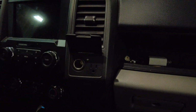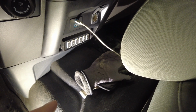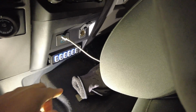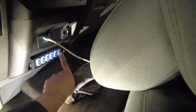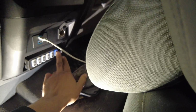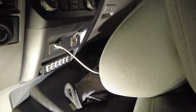Oh, on this truck we have a control box down here. Kind of hard to see though. Let me get a light. Okay, so on this truck, you can see there's a control box right there. And this is kind of cool. It came from STL Lighting. Basically, always hot. Every one of these buttons is fused, and it's a circuit, except for F. F, when you press it, is just momentary 12. So F allows you to change patterns. So any one of these can be a light, and F just applies 12 to the light. So the cool thing is you can change patterns.